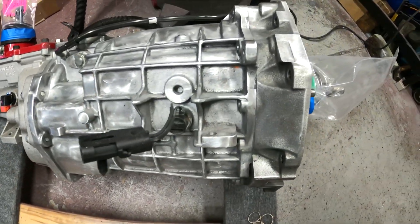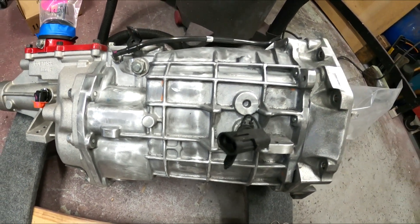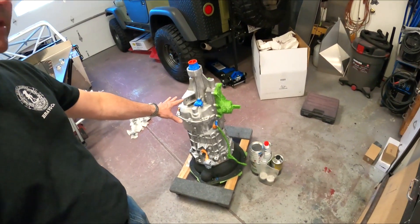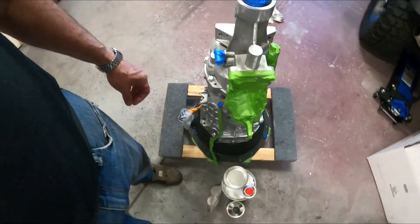Okay, we got the other side pretty well cleaned up now. We'll go through and touch it up — I couldn't get into a couple of areas so we'll wipe that down with some acetone, probably have to do that by hand. I'm going to continue prepping the T56 for paint. It's been too cold the last two weeks, so I've been cleaning it up with Scotch-Brite, paddling it, wire wheeling it — whatever I could do to get all the crevices and get rid of all the casting flash. I've had the transmission sitting in front of a heater overnight to keep it warm, because if I can get the transmission warm then when the paint hits it'll still dry.